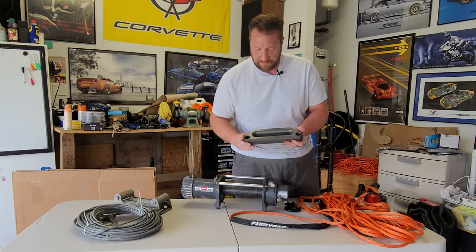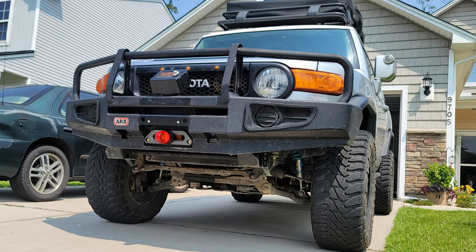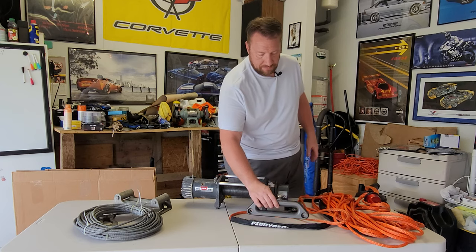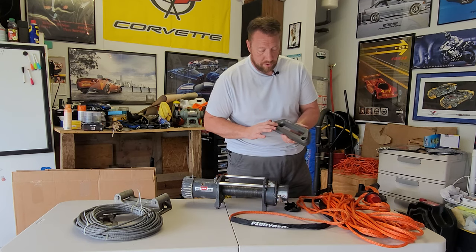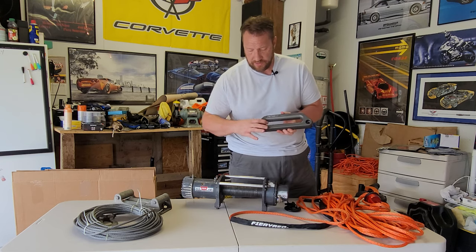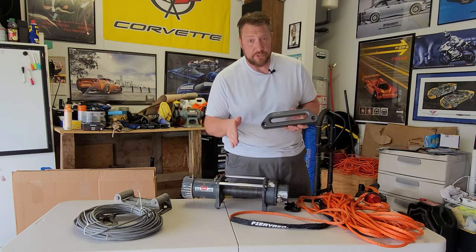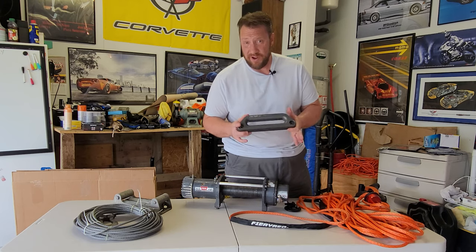Also, at the same time, I installed this Factor 55 offset fair lead. Apparently these offset fair leads are particularly difficult to find. Janky has an ARB bumper on the front, and apparently ARB decided to do things differently than the rest of the world - they mount the winch feet forward instead of feet down. And that causes some issues and you can't use a standard fair lead. You have to use an offset one like this. I ended up purchasing this Factor 55 unit and I just couldn't be happier. That thing's nice. It's a full inch and a half thick. It has very large radius corners on it, and the radius coming to the outside is very open and large, which is one of the advantages of it being so thick - they can give you that big radius so it doesn't pinch and chafe on the rope. It is a whole lot lighter than the roller fair lead that you have to use with the steel cable. Whenever you switch over to a synthetic, you need to get yourself a Hawse fair lead, be it offset like I need or just a standard one.